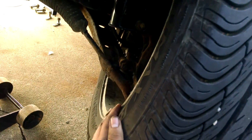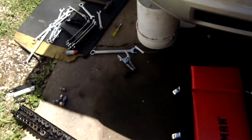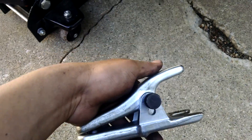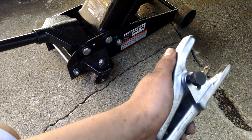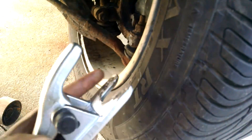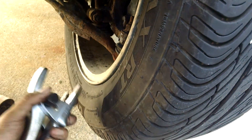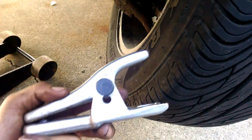Something that was actually very difficult to do was to take the ball joint out of the knuckle. I've seen some people try to hammer a screwdriver in there after they take the pinch bolt out. But what I found to be really easy and simple was to borrow this tool from AutoZone — this is a ball joint separator, it's an OEM brand, I think it's 27083, don't take my word for it. Basically what you do is you hook it on the boot side and then this side presses the stud down. You tighten it and it presses down. This tool made it extremely simple and easy to take out, so I do recommend doing this.